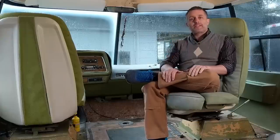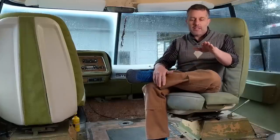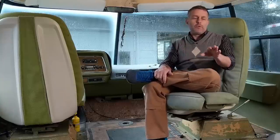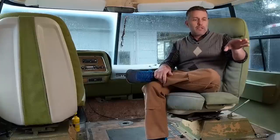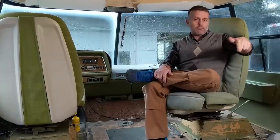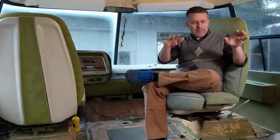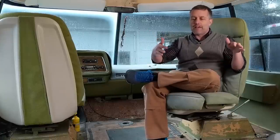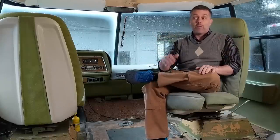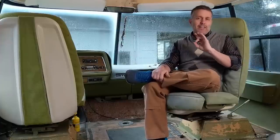So there's one more piece to this puzzle, and that is the fact that I was already planning on removing the two plywood subfloor pieces here at the front of the coach. And I'm removing those in order to install the brackets that will mount the shoulder harness, reclining seats to the frame right here. So while I'm in there doing that job, I can put some other bracketry in there to level the sag on the coach. And once the sag problem is addressed, I can then install the step without having any problems.